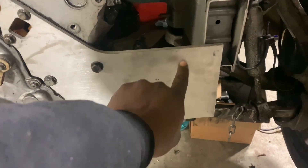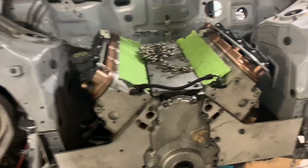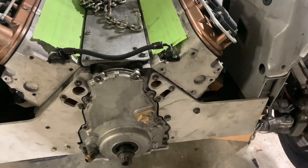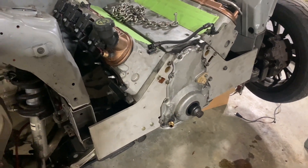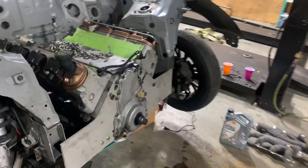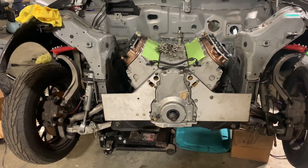Before they were up and forward; I have them down and forward now. I just have to cut a circle in here to clear the V-bands. I'm going to cut this one off also and V-band that one too, and then it'll pretty much be coming out. The turbo will be sitting about right here, and the exhaust will go out the hood again — not out the bumper, because the bumper I'm putting on is fiberglass and it would tear that up really fast. I also got a new hood, so I'm going to work on getting the front end lined up and building a tubular section so I can put hood pins in that won't come out this time.